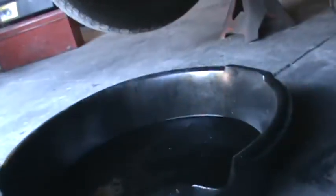Here's your rocker arms. You want to make sure that all your little clippies look good when you're looking in here. You got little spring washers. You got these clips. These clips almost never come off. Usually what happens is the spring washer, the wavy washer, breaks. So you always want to take your finger and run it along the bottom here and make sure you don't have any chunks of washer. Normally it'll be in the valve cover if you do. So there we go, we didn't have a lot of oil in there. But I think this has been sitting for quite a while.